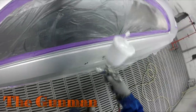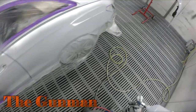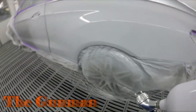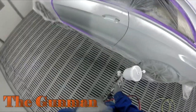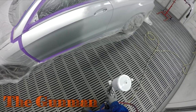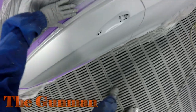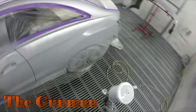One thing I'm always conscious of is not putting too much inside those door jams — I just put a light coat over there. That gap where the quarter panel meets the door: you don't want too much wet-on-wet primer in there, because if the color doesn't follow it in and it creeps too far, you're going to have a nasty edge. You may have noticed that big edge on the quarter panel starting to show up — I wasn't sure how it was going to dry down, or if I'd need to give it a light scuff.